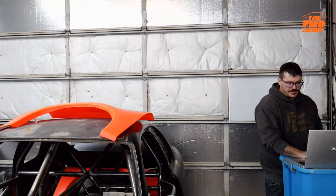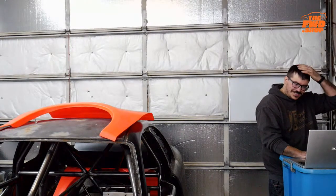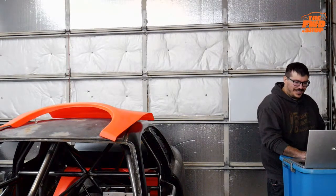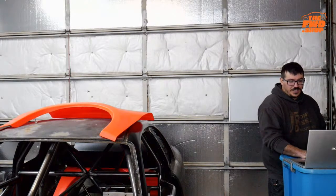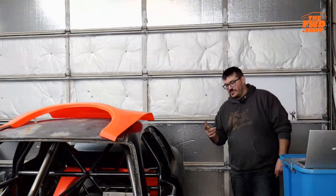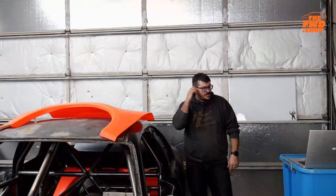So many drop sounds. Tech guy studying till 1 a.m. every night to tell the difference between Shadow and Neon Knuckle. Actually, it's super easy to tell the difference. Just look: if it has bolt-on wheel bearings or a bolt-on brake caliper bracket, it's not a Neon strut or a Neon Knuckle. Well, technically, the SRT4s had bolt-on ones, but they didn't have bolt-on bearings. So, yeah. But you would need to know that part, right?